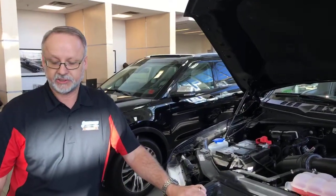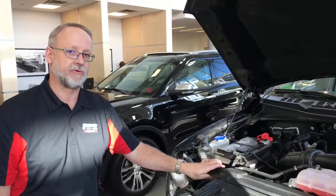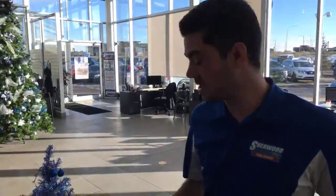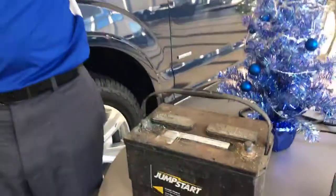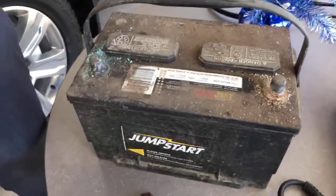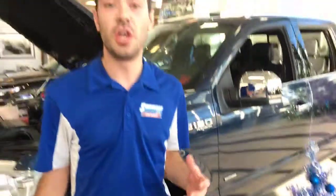One of the other things you're going to want to do is maintain those connectors. We've got a sample battery over here. This would be an example of the opposite of one of the newer batteries we put in all the Ford models. Where that is a closed model, this would be an open model where there are actually water levels that you need to check. So this would be a non-maintenance-free wet cell battery. The maintenance-free ones, you don't need anything - all you have to do is clean the connections. On this one, you do have to worry about the water level and your electrolytes inside the battery.